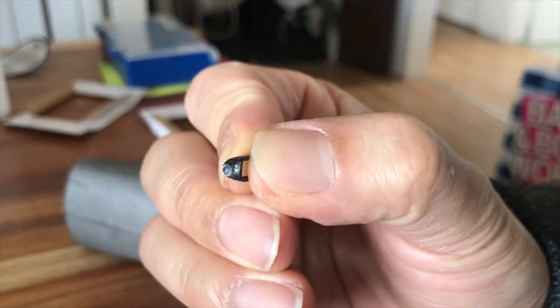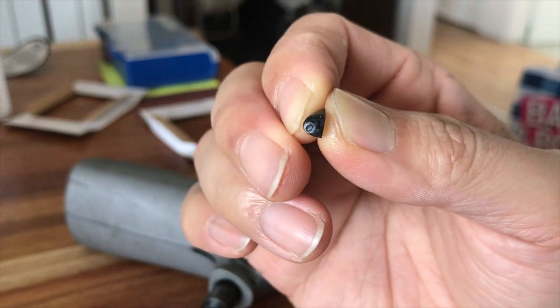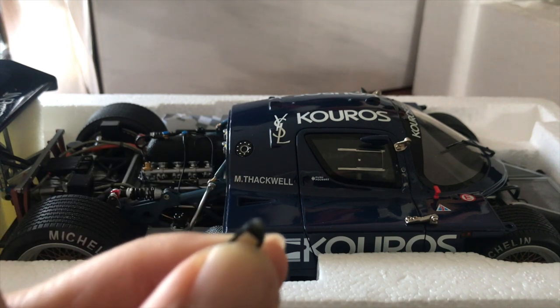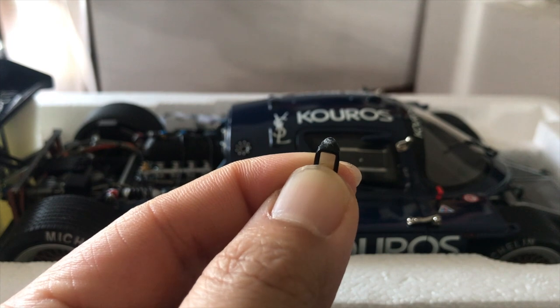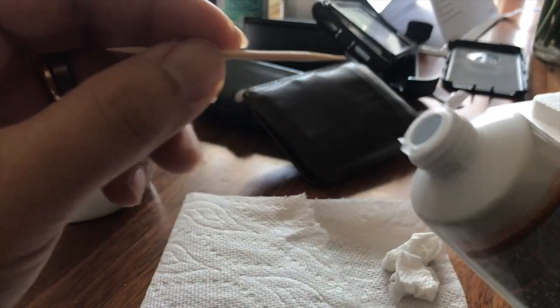As you can see, I'm pretty happy with that mating surface — it's nice and flat now with no sign of any bulging. I'm going to clean this part and the stem on the car before applying the glue. One thing to mention if you're going to do this type of fix: less is more. Take your time. When grinding, I'm only removing micro millimeters — just scratching the surface — because if you do too much you can't go back.